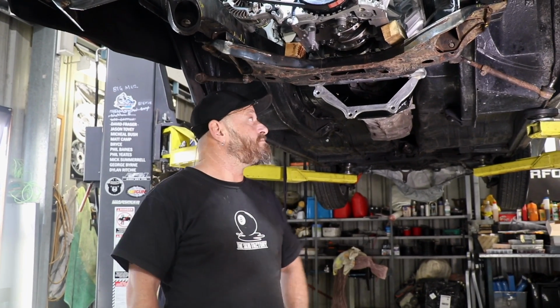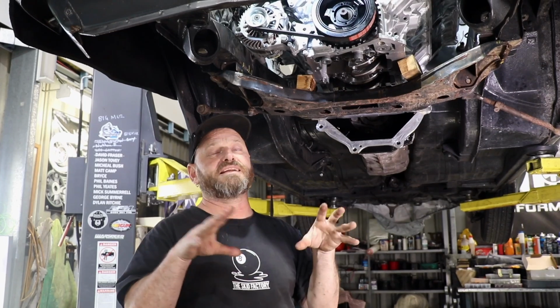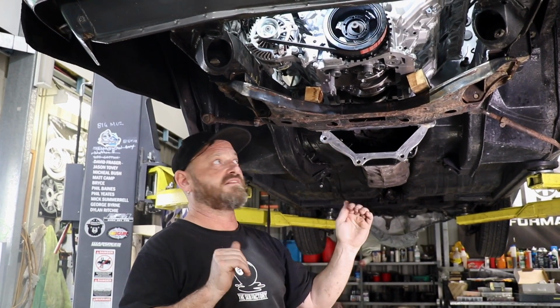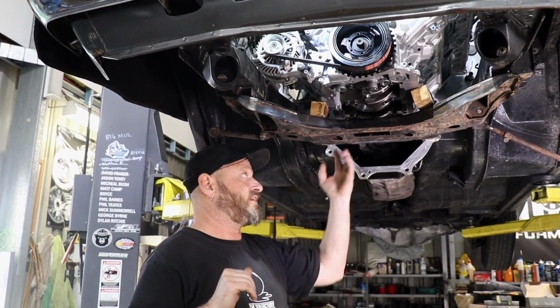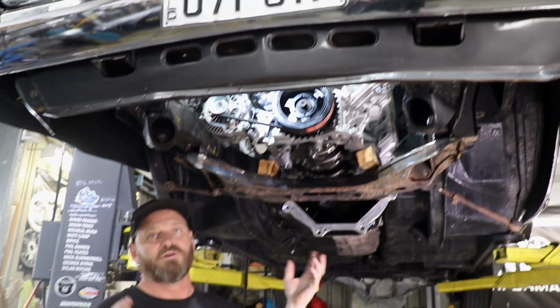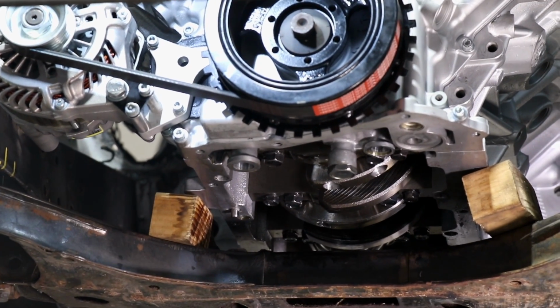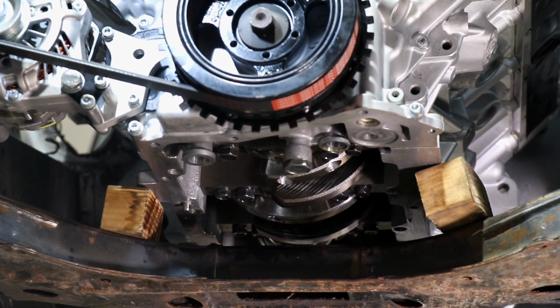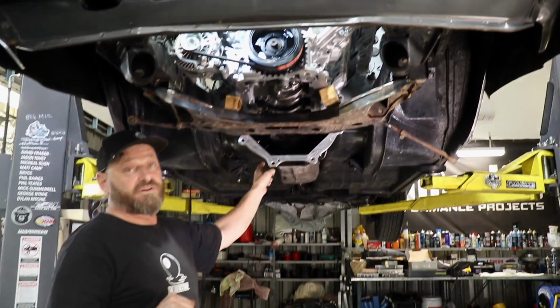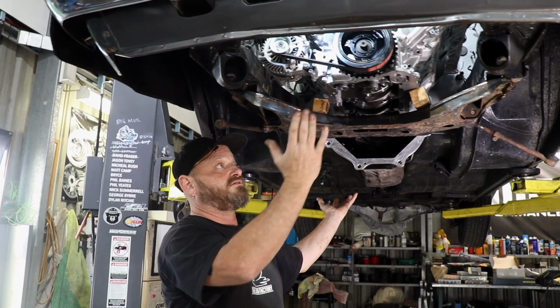Here's where we're at the moment. We've got the engine sitting in there where we would ideally want it, like height-wise, it's as low as we can possibly get it without banging into the steering rack. Even then, we've only got probably maybe 15 mil between the rack mounts, which are a little bit higher than the crossmember, and the pan rail. The gearbox, once we cut out some bits there and trimmed a few bits off the side, it's fitting nicely. It's actually, the engine's on a good angle.